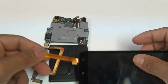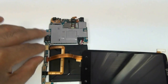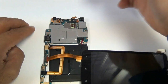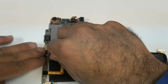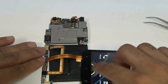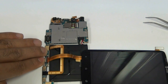Before continuing to show you how to put the phone back together, I'm showing you how to test out your LCD display to make sure it works. The LCDs on these phones are extremely delicate. The flex cable has to be completely plugged in — here I've put it in but haven't pushed it on the jawbone connector and the LCD will not cut on. In the next viewing, I'll show you exactly how to push the cable all the way in and push down the jawbone connector. This time the LCD will cut on — you can test that by pressing the little power button on the top. Be very careful with that flex cable. Please note at this point your touch screen is not going to work because the touch screen cable is not plugged in. That's a great way to test your screen.